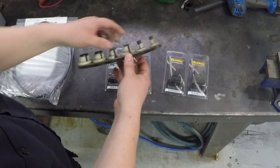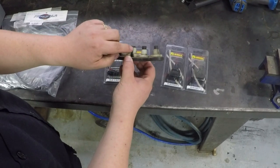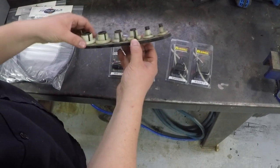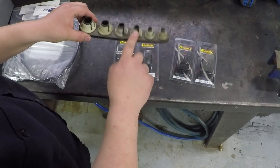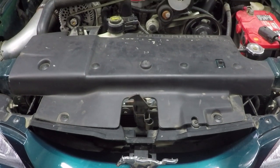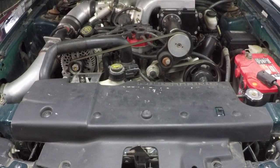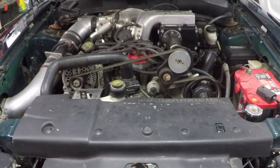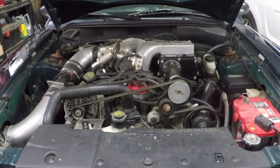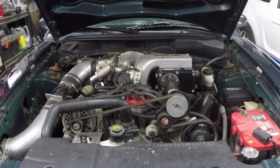Let's talk a little bit about tooling. You will need fuel line disconnect tools — if you've never used these before, take a look at the ends; if they are squared off you'll want to shave a chamfer into them, otherwise they won't work very well. Before you get going, we will be working with the fuel system, so it's very important to have the engine cool to the touch and to have some sort of fire suppression system nearby — ideally a fire extinguisher rated to deal with petrochemicals. A fire started while working on your vehicle is no better than the fire from the problem you're trying to fix.